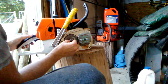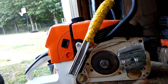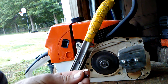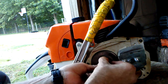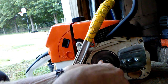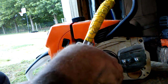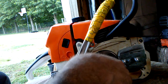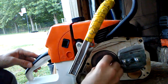Got that back in place. Let me get you really close so you can see what's going on here. Now we're going to put the E-clip back in. There's really no wrong way to put it in. I sometimes will reverse it — it'll develop a burr on one side or the other, so just reverse it every so often. Set that in there with a pair of needle-nose pliers and pop it back in place. There we go — you heard the pop, so we're back in the groove.